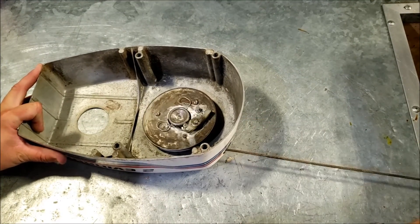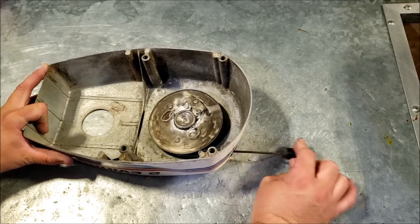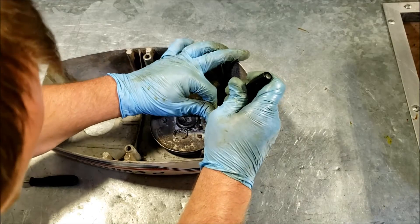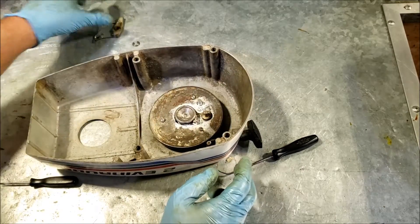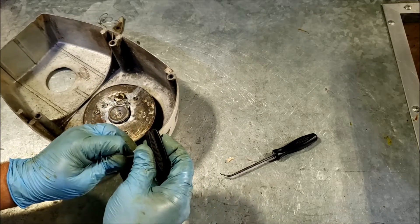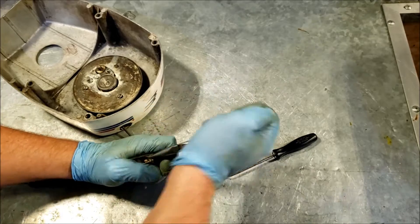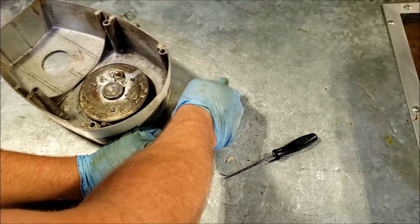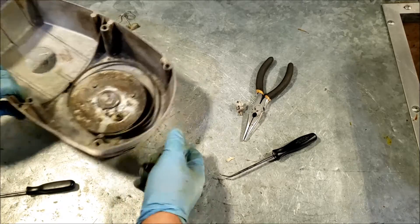You can't really tell, but it looks like the spring is coming in and out of its little housing with every turn, for its little clip. It's a little weird. Also, I think the spring is broken and bent over in a repair attempt. We're gonna need some work here. So we should probably clean all these parts to start with. Clip off. Pulley and spring off. And that's kind of what we're left with. Get the rope and handle off for them. We'll try to let the spring rewind so it doesn't blow up in my face in a minute — which it will anyway. No doubt there.